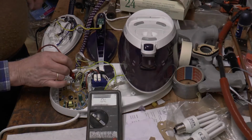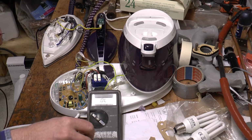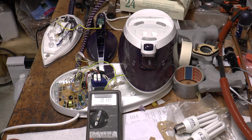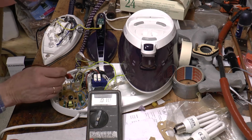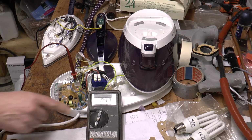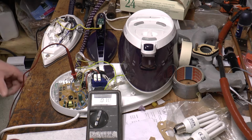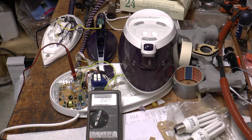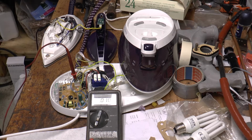inside this wire loom. And to be 100% sure, we can run another test, which is to create a bypass of the yellow wire inside the loom by setting the multimeter to current, which means that the current will run through these testing wires, and then do a reset of the system and see whether it will start up.